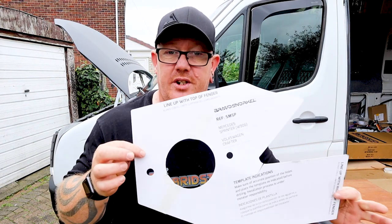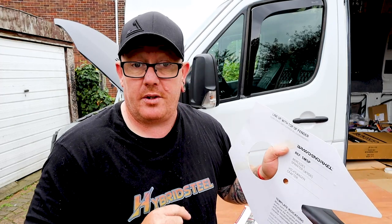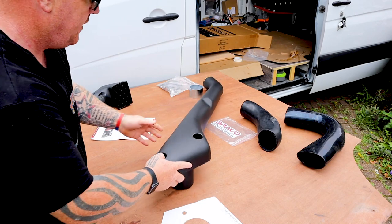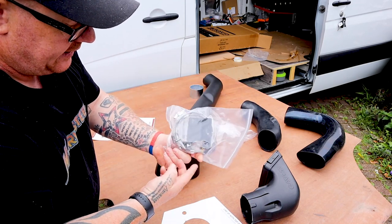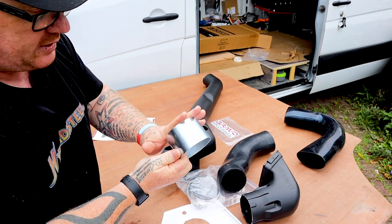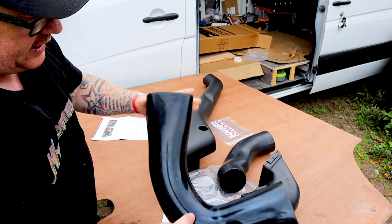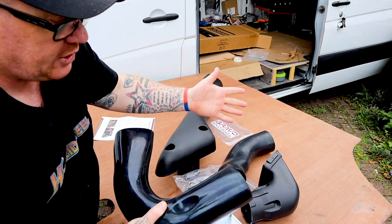So if you go into places that are like deserts or sandy or dusty or snowy, a fitted snorkel is going to give your engine fresh, clean air all the time. The Bravo snorkel does come with a template, which is this. As you can see, this one is for a Mercedes Sprinter and a Volkswagen Crafter. Ours is a Volkswagen Crafter, so it would be the same job if you're doing it on a Crafter as it would be on a Sprinter. In the actual snorkel kit, you get the main body of the actual thing, which will bolt on the side of the vehicle. Then you have the head of the snorkel. You get a bag of clips, rivnuts and things like that to tie it all to the van and keep it all nice and safe. You also get two flexible pipes which will bend really well. You get an inner section pipe as well, and there's also a moulded pipe — still flexible — that is moulded to the intake of the van. So the intake in the van is that shape, and it will go on the side of the airbox, and then this piece will swoop round and connect to the actual snorkel itself.